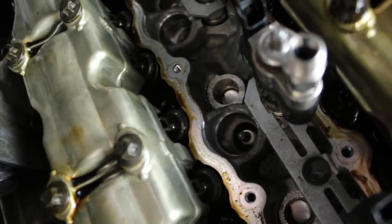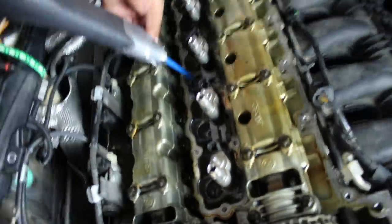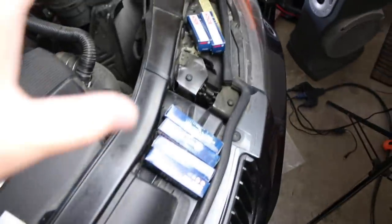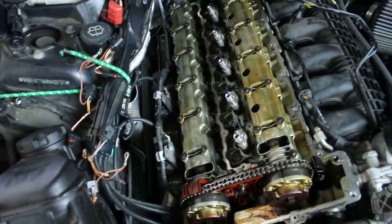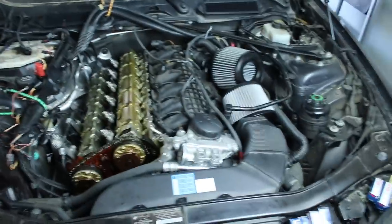We saw apparently oil inside of the spark plug wells, so we're gonna suck that out with the shop vac before we switch out the spark plugs so none of that gunk and oil gets in. While we're already in here, I got some new spark plugs — gonna go ahead and throw in all the new spark plugs. I might even hold on to the old ones just in case one of these didn't go out prematurely, always have a spare. We're gonna do that, put back the gasket and everything, and hopefully no more smoking.